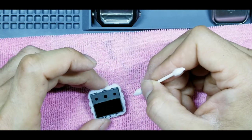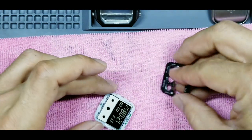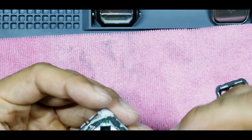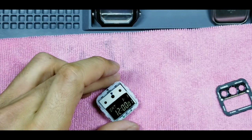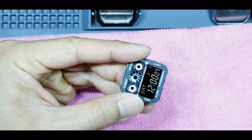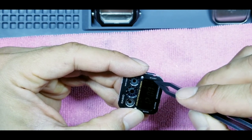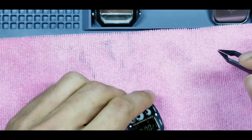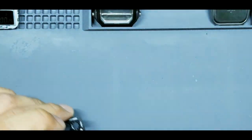Test-fit the masking over the display. Reset the watch so the top display is running. Then place the masking on and check that you don't see any exposed bare glass beneath the polarized score line or in the window above. That looks great.